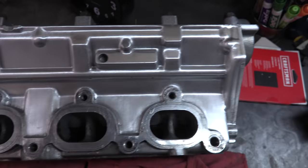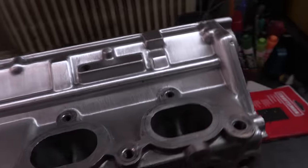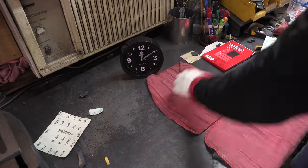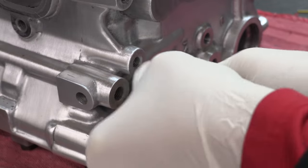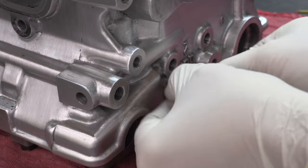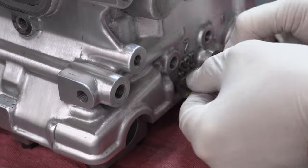I made it all the way through the previous cut so that no horizontal lines are showing through, but it's right about this time that I can't help but notice that I'm not moving any faster at all than I did in step two. That twice-as-fast-per-grit thing is something I obviously failed to remember correctly about this job — but now I remember why. It's because crossing the grit with the same grit is what takes half as long. The first cut with the next grit seems to take exactly as long as the previous one, so sorry if you were looking forward to that. Thanks to the magic of movies, we'll know exactly how long each one of these steps takes by the time we're finished.